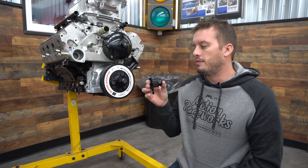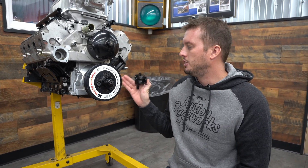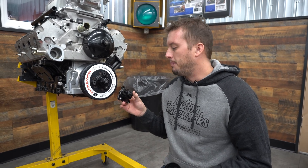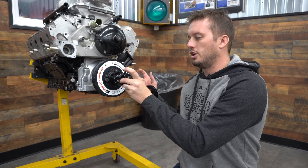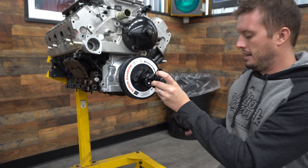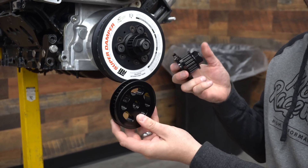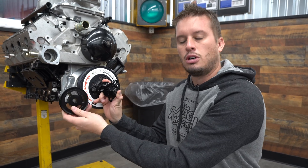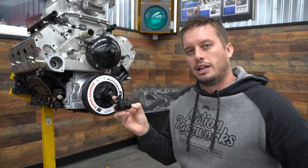In addition to that bracket, we also have a new mandrel. This is a three-bolt mandrel developed for the Coyote platform, and it also happens to work on an F-body / GTO spacing ATI damper for an LS engine. It bolts right on the front, comes with bolts for use with AC or standalone. It features a 16-tooth HTD pulley with a 32-tooth matching pulley — you split it in half. A lot of folks run these engines around 8,000 RPM, so that'll give you the desired 4,000 RPM mechanical pump speed.